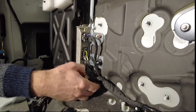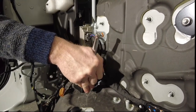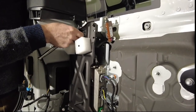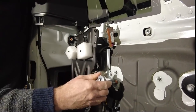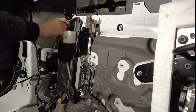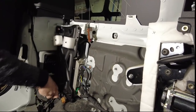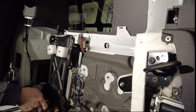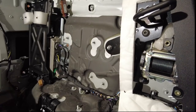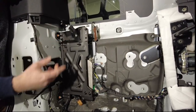These last two ones there — I've done them in the wrong order. When you've got a slotted hole you should do those first and let the slots ride, otherwise we'll be stressing. When those are done, get the slotted ones: 10 Newton metres — nine, ten. Be careful of those wires there, don't be stressing those too much. Right — I think we're ready now to get the main unit on. Let's have a check of the instructions.